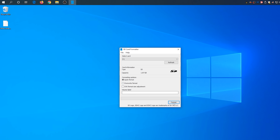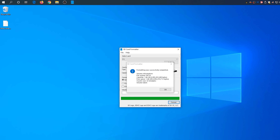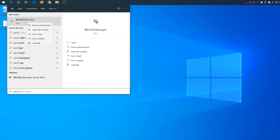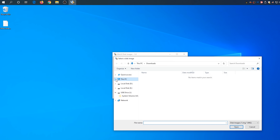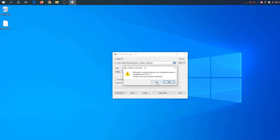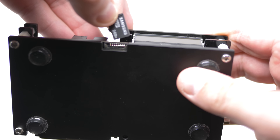Then use the SD formatter tool to format a microSD card. I suggest using one that's 2GB or smaller, just to ensure compatibility. Then run some kind of disk imaging software, such as Win32 Disk Imager. You have to run it in admin mode, and also make sure your SD card is selected, then load the bin file you just downloaded. With Win32 Disk Imager, you'll actually need to set the dropdown menu to all files in order to see the file at all. The OSSC can't just read files off of a card like a computer — it needs to be imaged like this in order for the OSSC's operating system to understand it.